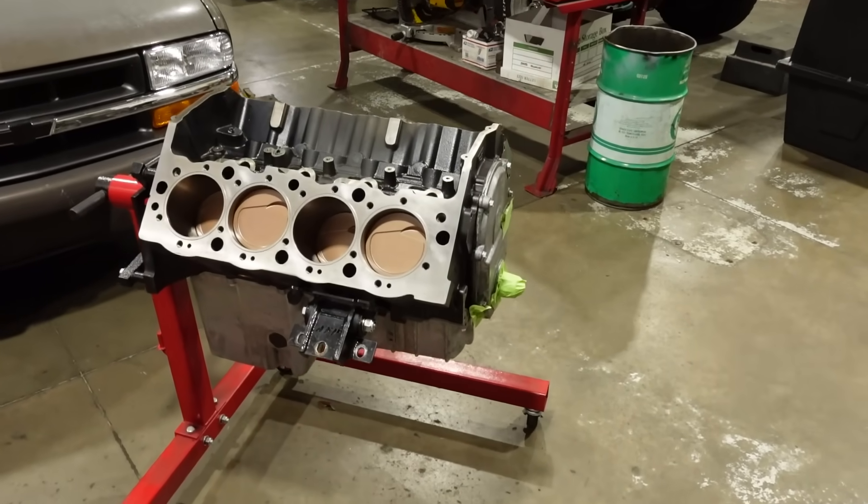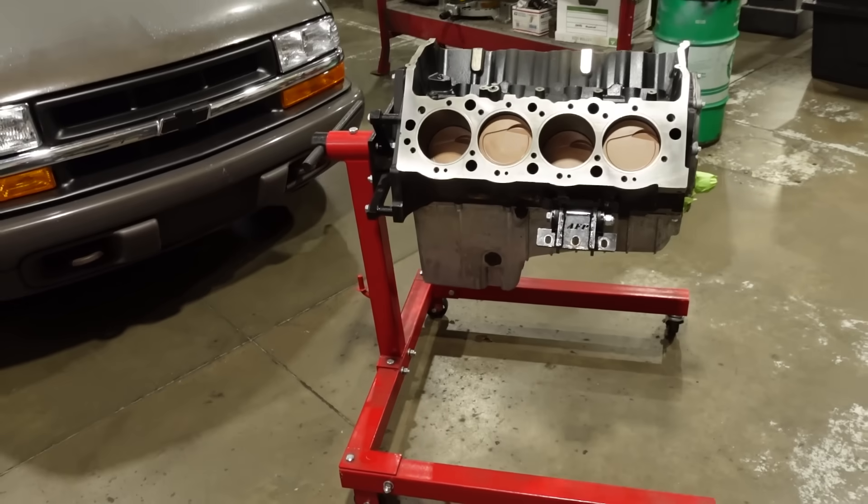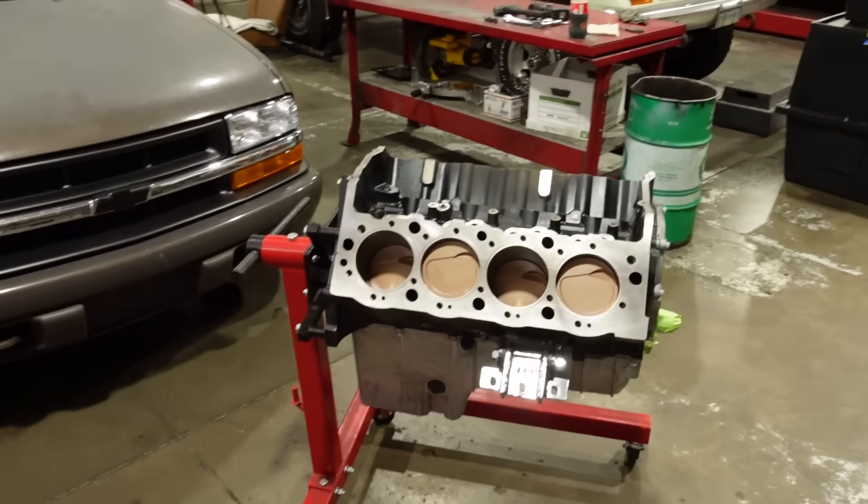It's now time to get working on it. I want to at least get the engine together. We're going to get the heads bolted on. The oil pan is not permanently installed because I have to put a windage tray on — custom stuff, of course. I have a big block Chevy windage tray that's going to need some modification. I need to get the oil pump in, the oil pump drive, and the pickup tube. I'm going to try to put some sort of trap door system in the bottom of the pan to keep oil under control. Then heads on, intake on — at least the engine will be buttoned up and ready to drop into a chassis. Once I have it ready, I can figure out what truck is going on top, and then we can start building the twin turbo kit around it. I do want to do twins. It is four-wheel drive, so I have to build the transmission too. That's the point where I stop thinking about it, because it's going to take another lot of money to get it to where it runs and drives.